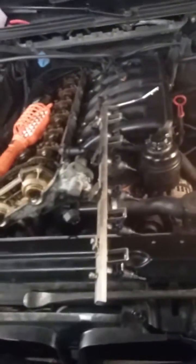To take the injectors out, put a screwdriver in between here and gently pry up. Slide this metal locking washer off, and your injectors will pop right out. Pry it up a little bit while pushing down, take that metal clip out, and your injectors will come right out. Have fun and relax — it's not that hard.